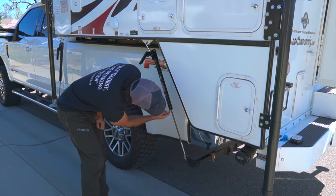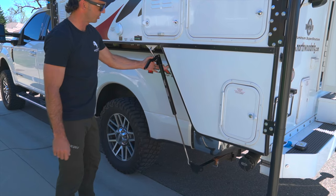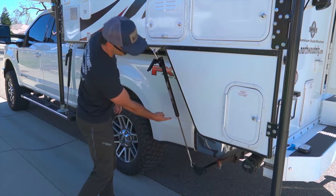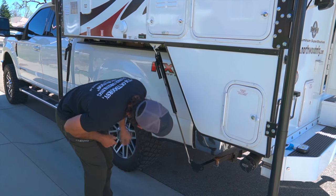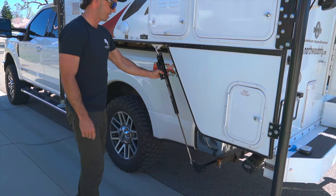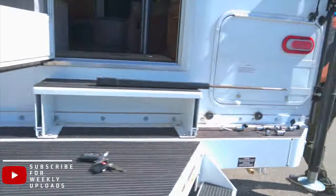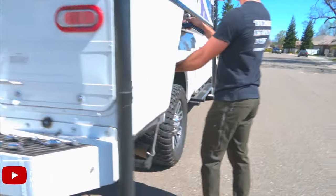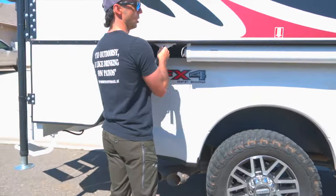So there's this little rubber grommet right here — you want to get like a quarter inch of play. You set it and before you tighten it you put that right to the top, and then when you push down there's your quarter inch of play, so now it's set. And you're not bolted to the bed of the truck at all — so you could literally drive the truck off the camper if you wanted to.